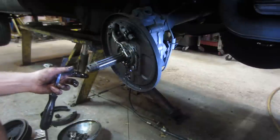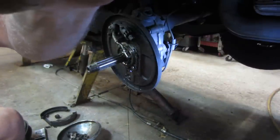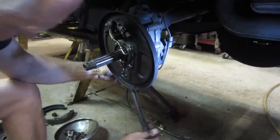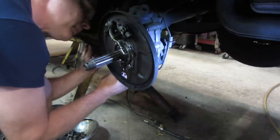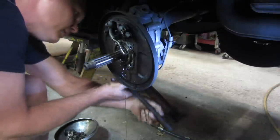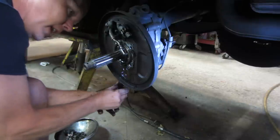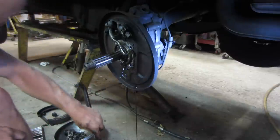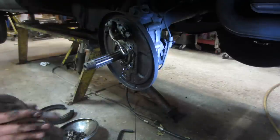I'm gonna pull the drain plug on the bottom, get all the fluid out of it so that we're not keeping on fighting that. The little metal bits in the pan are not a good sign. I just hope I don't have a gear issue in there, because I do not have any gears for it. I do have stuff for a 1-ton, which is '64 and up. Like Lucy, but not this one.